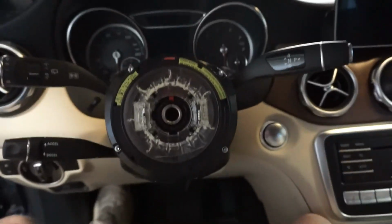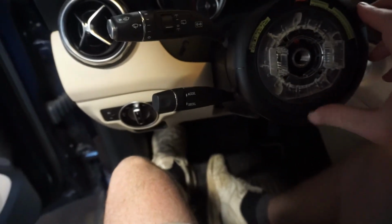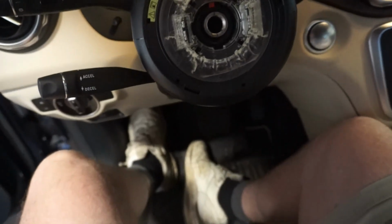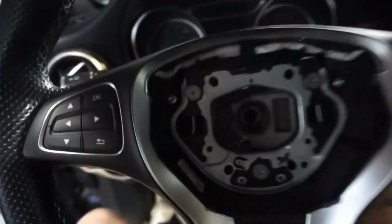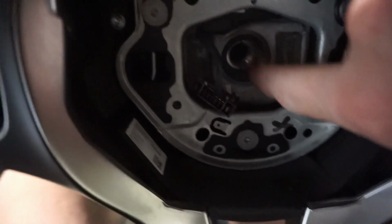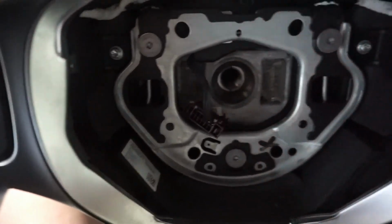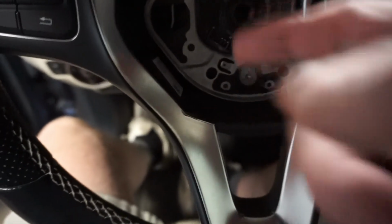And the next thing is this little trim piece. Just goes on like that. Clips on. And then next is the steering wheel. Just kind of slides in, and you have to remember where things are. I don't know if you can see in there, but there's a line in that shaft, and there's little arrows on here. Those are lined up perfectly. So then I do that, and I put a little bit of blue Loctite on here and bolt that in, and then I'll check back.